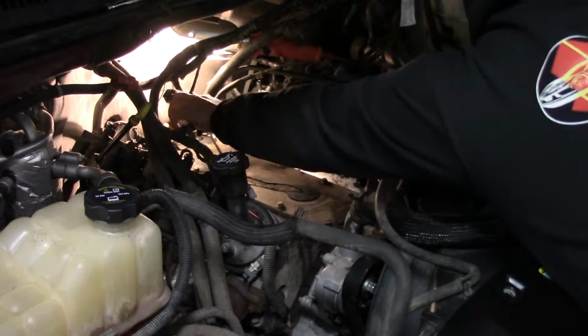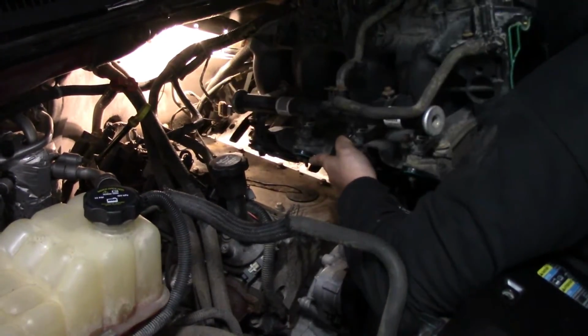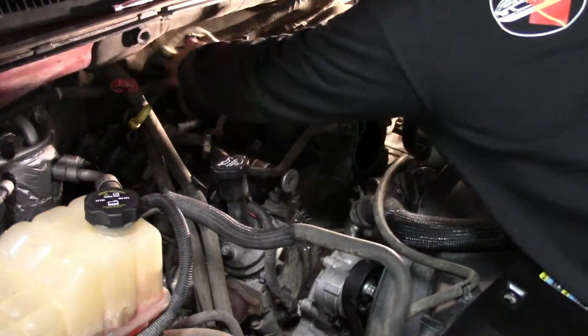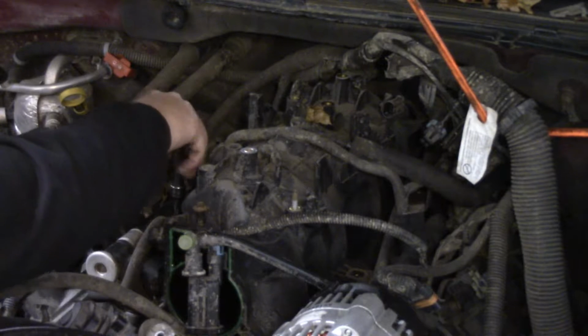After replacing our intake gaskets, link will be in the description below, we move on to the reinstallation of our intake manifold. Torque the intake manifold from the inside out with 89 inch-pounds. See the diagram now. Here is the intake manifold torque sequence.